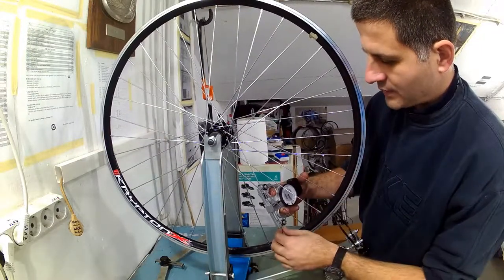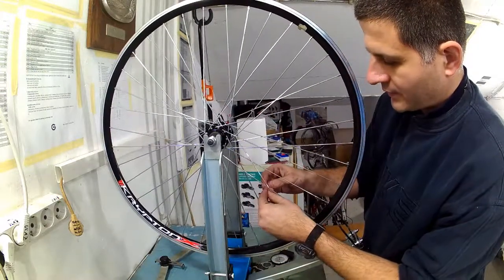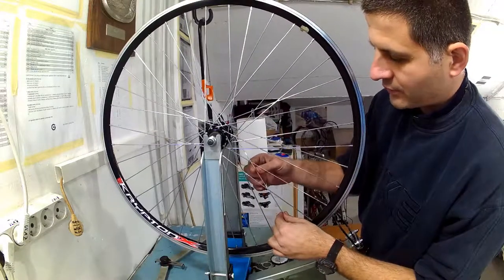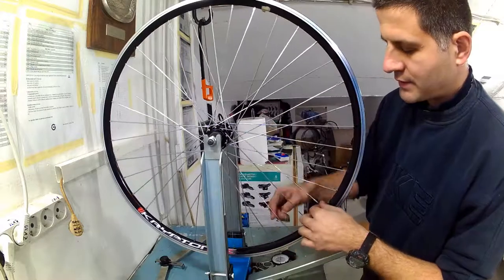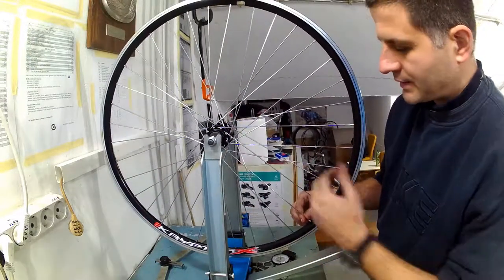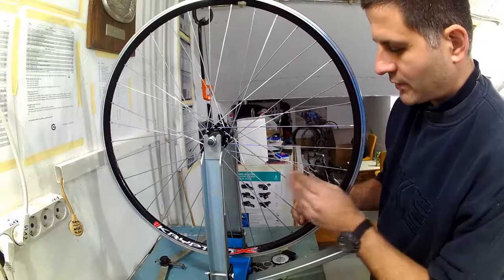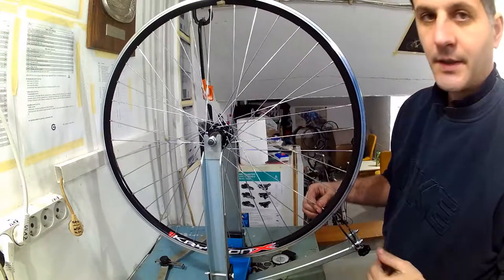I will go around the whole rim and see what the average tension of each spoke is on both right and left hand sides, then make another go after I determine the goal tension that most spokes have, so I need to make adjustments to the least number of spokes. I will mark spokes that have much higher tension than the goal and ones that have lower tension. Spokes within 10% of my goal tension will be left as they are — that is acceptable — but all others will have their tensions compensated and adjusted so that they are all uniform.